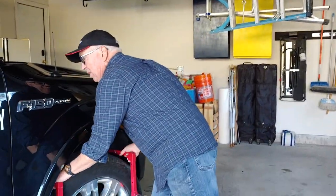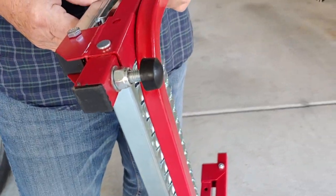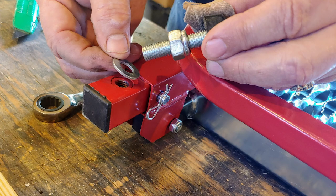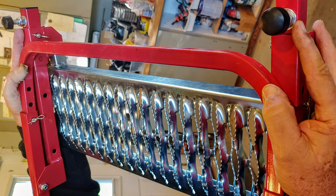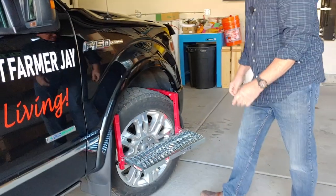There's one other little thing you're going to want to do to improve your experience with this. We found that when you fold it up and it's riding around in the back of the truck, as it came, it did not have a nut and washer on it, and the bolts would simply ride in and out. As you can see in this shot, one bolt is out further and the other is in. So what we did is remove the bolt, install the nut, travel it up the thread a little bit to give room, put a washer on, reinstall it, and tighten the nut against the steel tubing. That locks it in place and it will stay from then on. It is every time just exactly where we put it, hanging up nice, level, and securely.